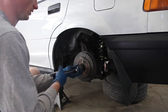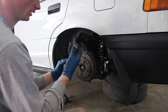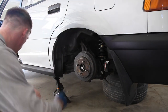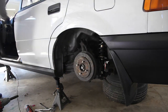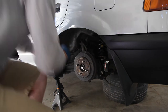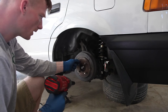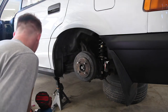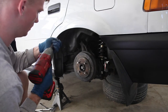If it's rusted — my other side was corroded at least — I used PB Blaster. This one actually looks pretty good. Now we've got to get this guy out. This is when you want to undo the e-brake, because the shoes on the inside will press outward and stop it from moving. But if we disengage it, it's loose and won't have a problem.